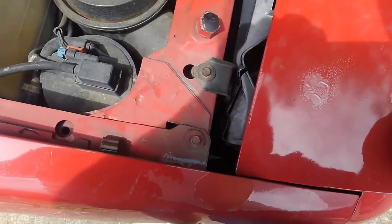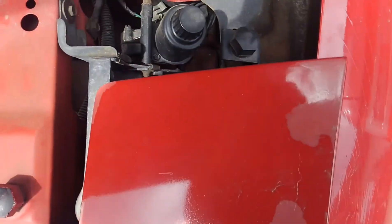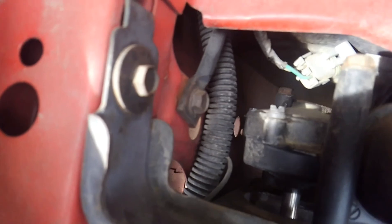And what that does is it raises the headlight. What I'm going to show you in a few minutes is that there are not too many pieces to this headlight assembly — it looks more complex than it is. There's a bolt here, a bolt underneath, and two in the front. It's actually missing the bezel, which makes it a little bit easier for us.